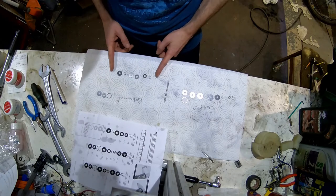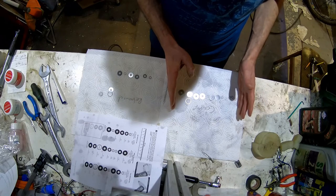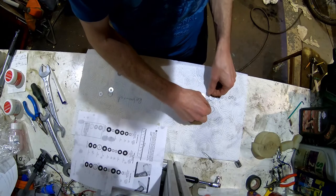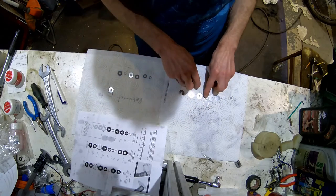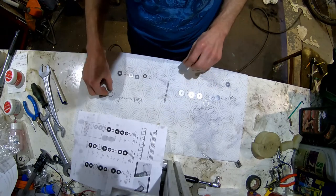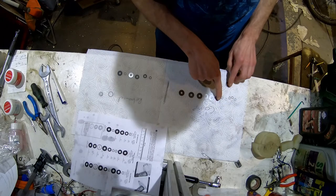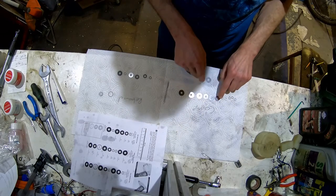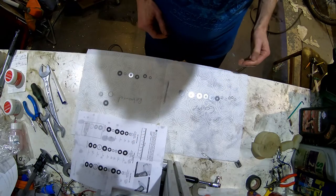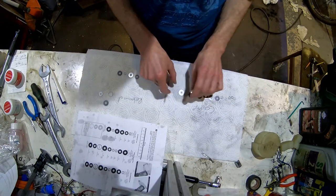So that's the new rebound shim stack at the low tune. This is the compression shim stack - first we're going to move this up two places, then exchange that with the slightly thinner shim from the rebound shim stack, and then swap the one taken out of there and put it to the top. So that's going to be our new compression stack and that's our rebound stack - we'll just put them back on.